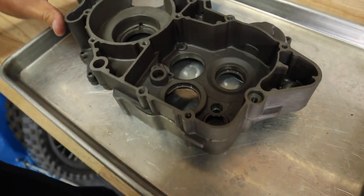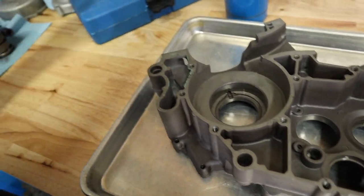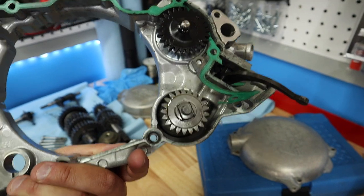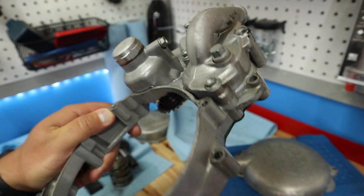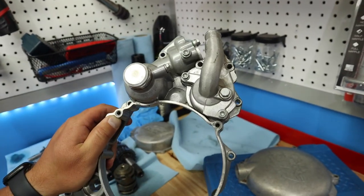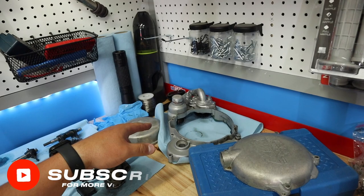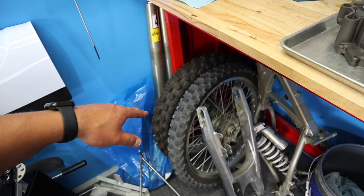There it is. We've got all our bearings out — I'm super pumped. That is a big milestone on the engine. Our engine now is 100% torn apart. We've got this clutch side cover right here — we got to rebuild the water pump in it, so I think we'll do that next video. Actually, we can't quite yet because I have to get this thing stripped and prepped for Cerakote. We are shipping our parts off this week to Josh to vapor hone and prep these parts for Cerakote. I think we're going to move on to the wheels — I got to get them apart so I can get them powder coated and ready to be laced back up together.